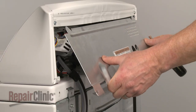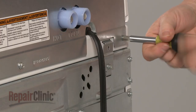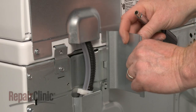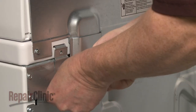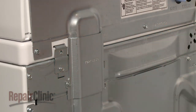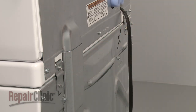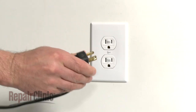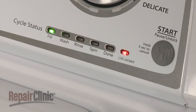Realign the upper access panel and secure it with the screws. Replace the wiring and tube cover and secure the screw. Reinstall the hinge screws, then remove the tape securing the lid. You're now ready to plug the power cord back in and confirm that the new lid lock functions properly.